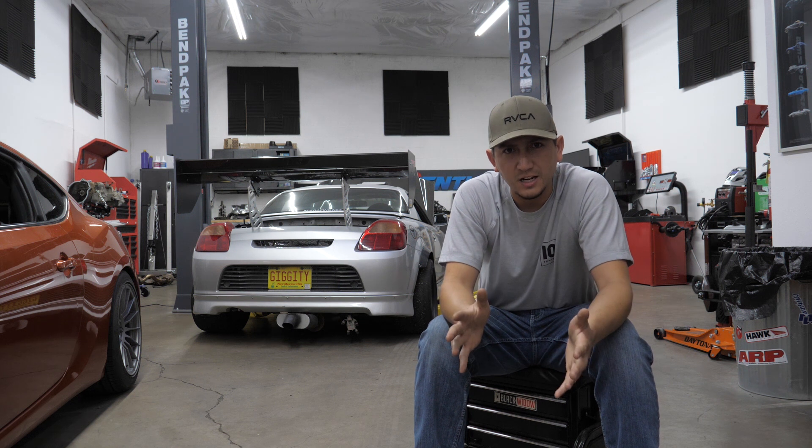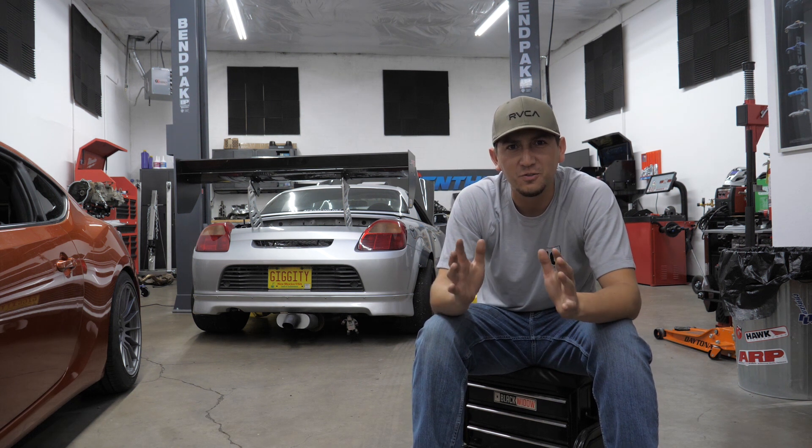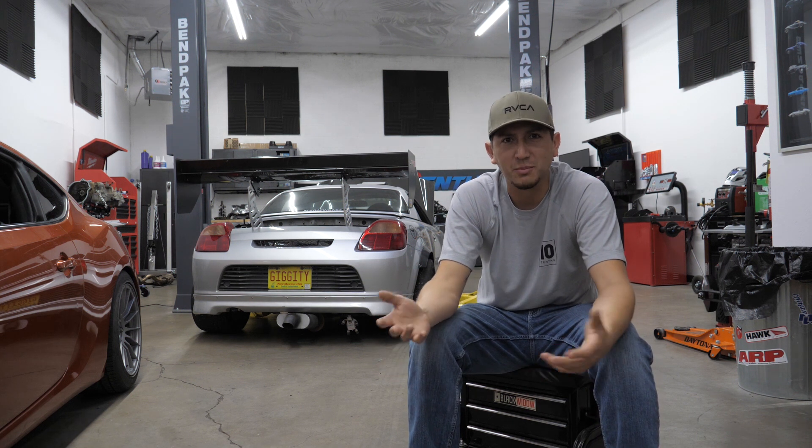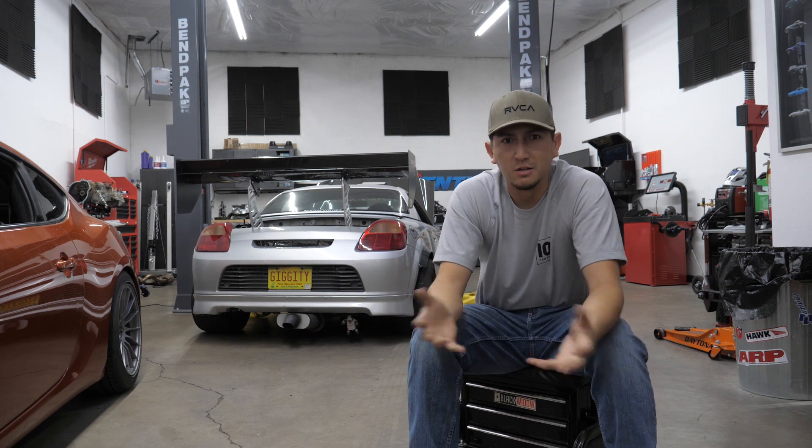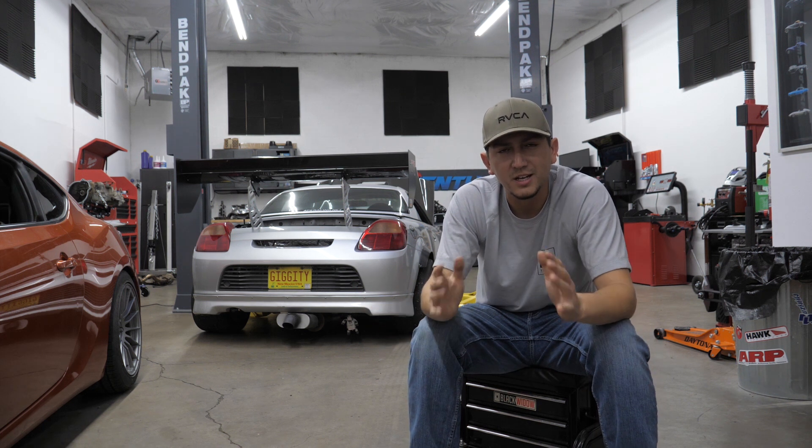Alright ladies and gents, we had something unfortunate happen — the car fell off the lift and it got shorter. We actually forgot to take video footage of the car coming down and its ride height, which I know is terrible, but we did our best. All things considered, to wrap it up: the springs went in really well, the alignment issue we had with the front top hats wasn't a problem at all — later on it settled just fine and the car drove great. We adjusted the tolerances in that strut mount bracket all the way in to provide a little more camber, and it seems like the car doesn't even need an alignment. The geometry of the suspension is such that apparently it doesn't get that messed up when you do that. We're really happy you guys continue to watch this stuff with us — we'd love to keep providing it, so please hit subscribe and hit the bell button. We'll leave you with some awesome photos we took of the car afterwards. See you next time, thanks a lot.